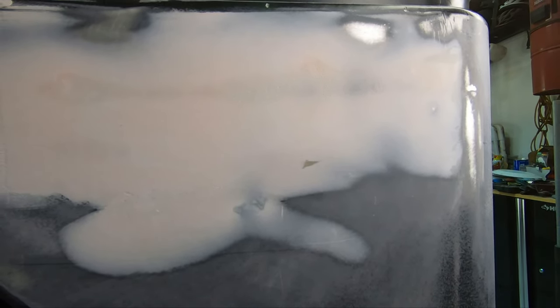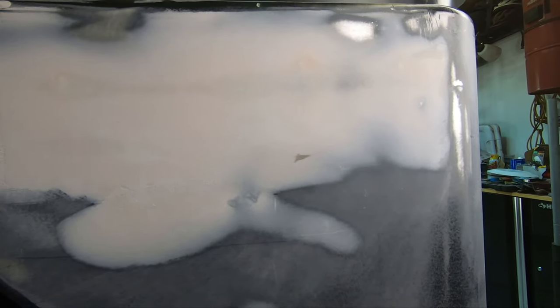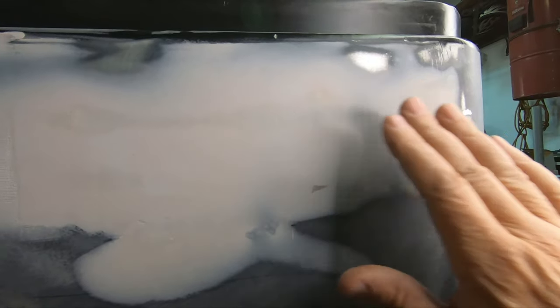All right, well, I think I mentioned that I put myself through college, or maybe I didn't mention that, by doing drywall finishing. One thing I learned by doing that was you've got to get the light going down the side of your wall, and then you can see what's really going on. Any place that there's still the rough surface, that's a low spot. So the sanding makes it nice and smooth. These are low spots still. So we're a little bit low here, and then you can see my line where I cut in. Didn't work very well there.